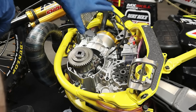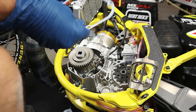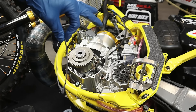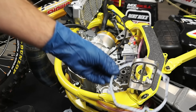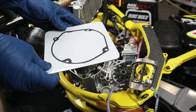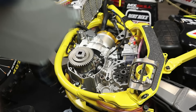Can we just talk about how sick your bike is? I'm jealous — that's crazy. Next up, we're going to throw on the gasket. I'm going to use a gasket that did not come in the kit — this is from the original engine gasket kit, it's paper and kind of thick. I'm going for some cheap insurance on an oil seal. That's not to say the included Panthera gasket is bad — it looks to be much like a Cometic brand gasket with a metal core, which is really good stuff. I just want a little extra cheap insurance from that thicker gasket.